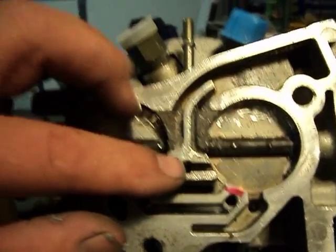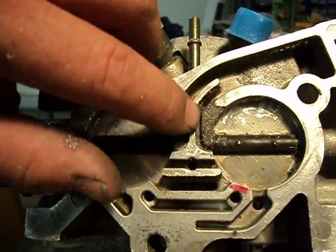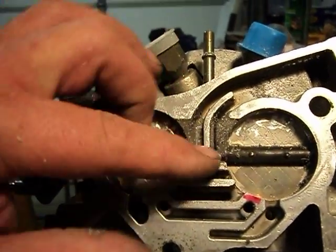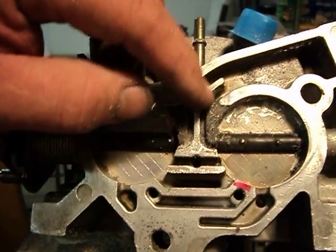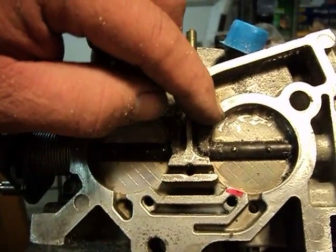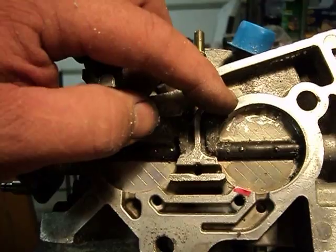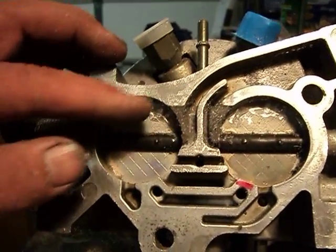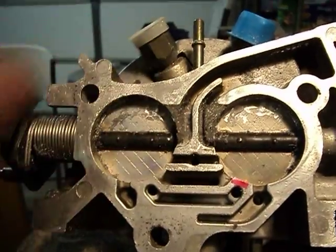The purpose of this is to get the idle air pathway open and leave it open some, but really you want it directed above where the groove goes. Because with the air dumping in here, it killed the wave. Not only that, but you could only put in that much groove from there to there, and you lost 25% of your throttle plate opening on both sides. So this has to be sealed, and that's how I opened it up. I hope that helps you all out — it's causing some really good results.